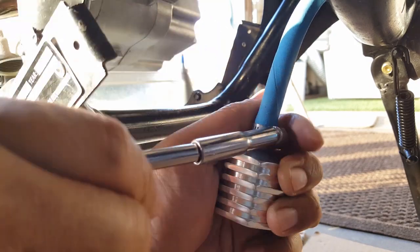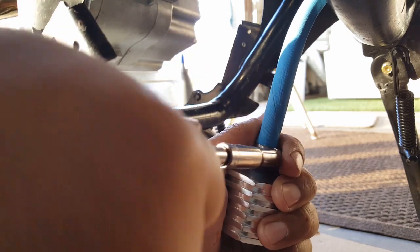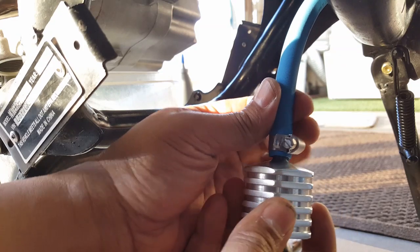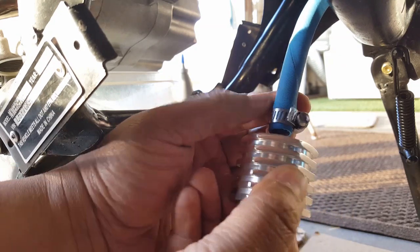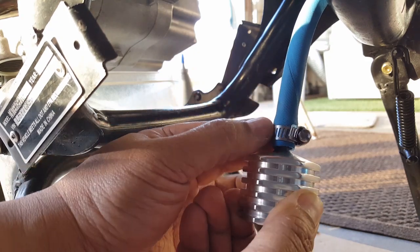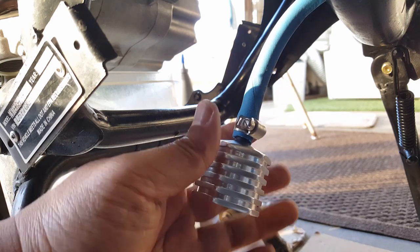I'm going to go in and hold it in place like you're almost holding a nutcracker. Just hold it in place — the tighter you get, the more it'll help and you won't have to worry about holding it too much. This one — hopefully it's not crushing the aluminum. You just want to make sure you do it tight enough but don't want to crush the aluminum — again, these things can be crushed. Okay, you can't twist it off the hose now, which means it's tight. You can see there's almost a little bump created — that's how tight it is.